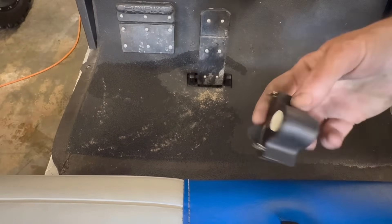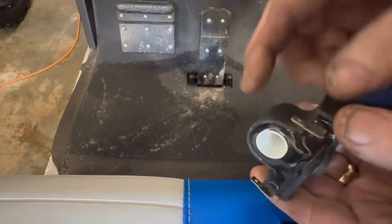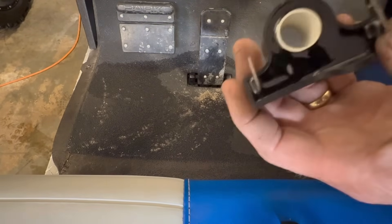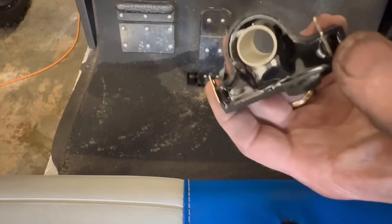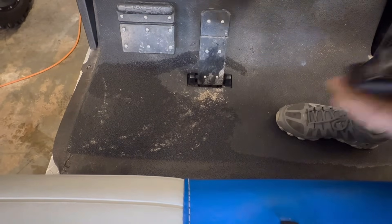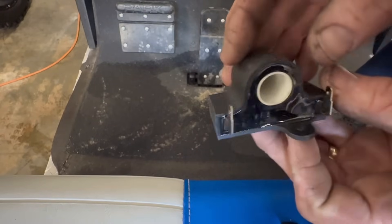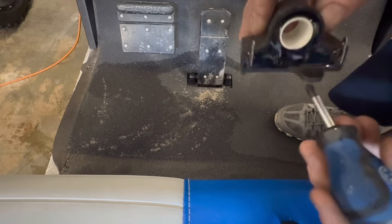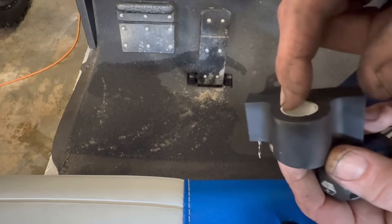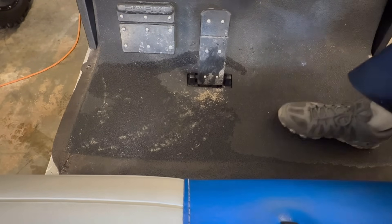This is your ITS here. You've got your black and your white wire. The black wire comes in, the white wire comes in — 14 volts in, 0.9 to 2.9 volts out. So you get 14 volts in and 2.9 at full pedal. There's a magnetized rod in there and the throttle rod goes through it. As it goes through, it compresses the magnetic field and gets tighter — that's what produces the speed signal and puts out more voltage.